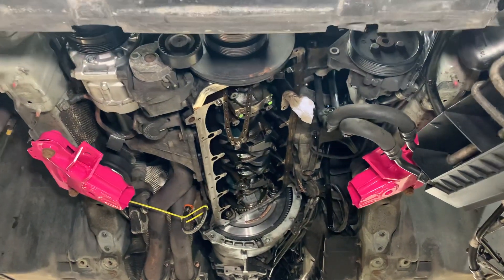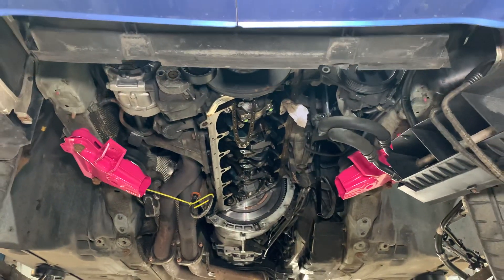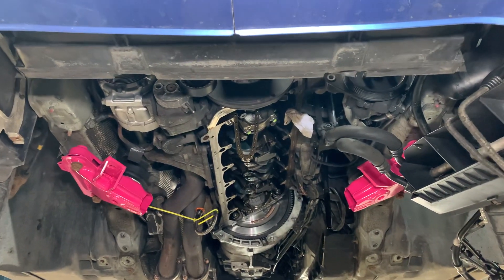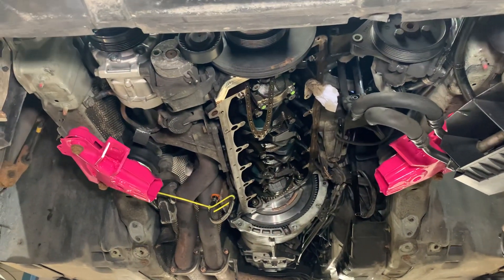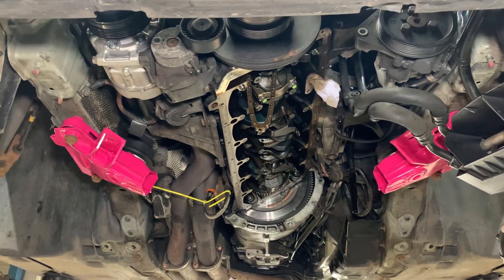You're probably wondering how the car gets to this condition, because as you can see it's a lot more disassembled than when it first came in. That's because we have to take off under trays, reinforcement plates, disconnect wishbones from your subframe, then remove your subframe and steering rack assembly in one piece and place that safely on the ground.